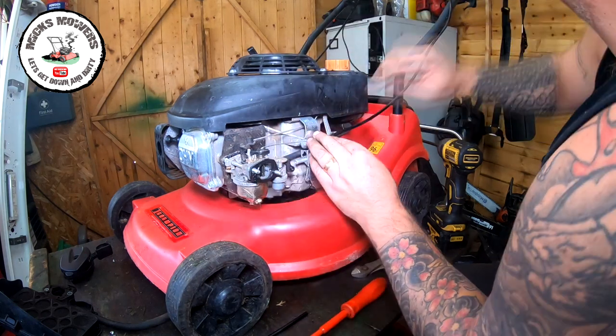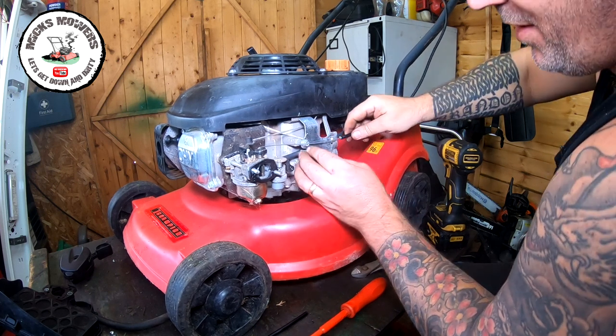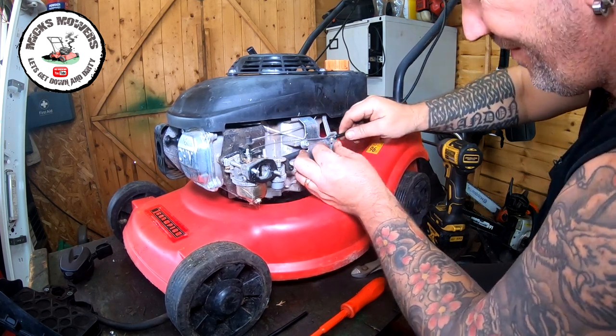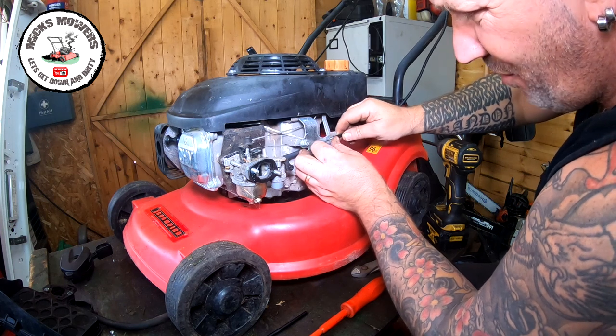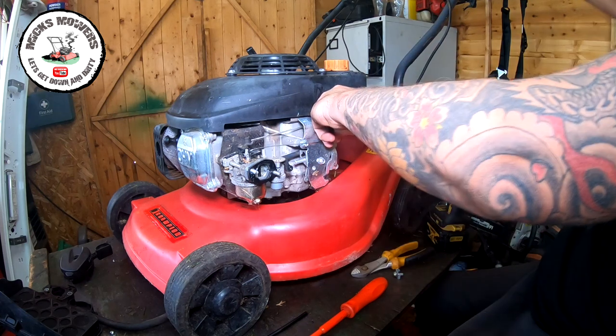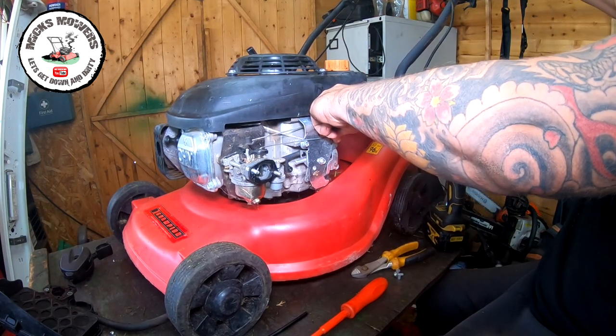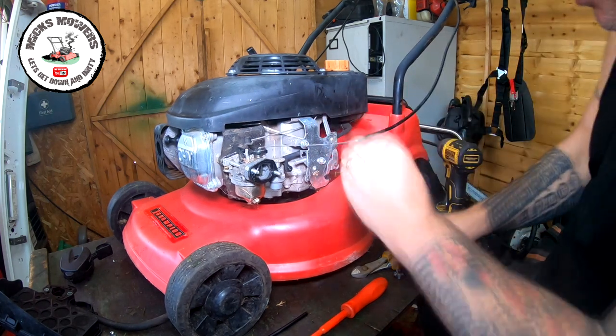And now we'll be set into choke all the way forward. I can now push that all the way forward, and that's going to be choked about there. That's where it wants to be. If I hold that and then take it off a choke, fully functional carburetor. Okay, so let me now do that up.